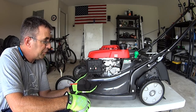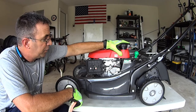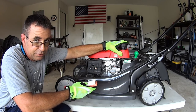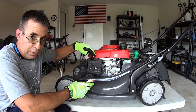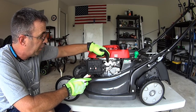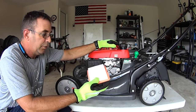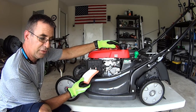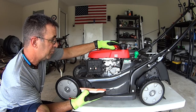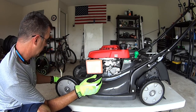I said I would show you the fuel shutoff — here it is, right here in the fuel line. There's a full tank of gas, but the machine's been up sideways and no gas is leaking out because we drained the carb by running it at the very beginning with the fuel valve in the off position. The tank is sealed. There is no maintenance to do on this carburetor this early on — that's just going to be spot-treating if something bad happens.